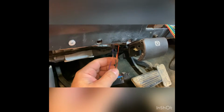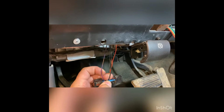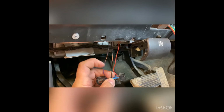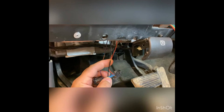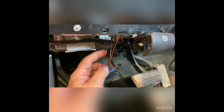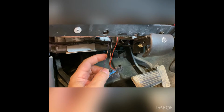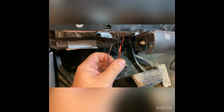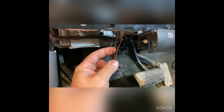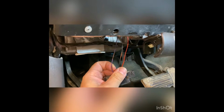And here's what we're doing at the OBD2 connector. So like I said before, we've got our single wire CAN, which is the purple wire in pin 2, and then we're gonna use the chassis ground provided at the OBD2 connector in pin 4. It's also incredibly important that you make sure that you don't accidentally short out this purple wire. There's a lot of information on this wire even though the vehicle is not running. So you definitely don't wanna short that out, especially because we have ground right next to it. So just be careful that these wires don't touch, and make sure that that purple wire doesn't touch